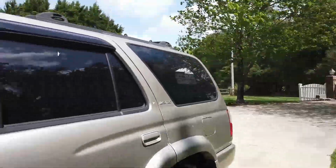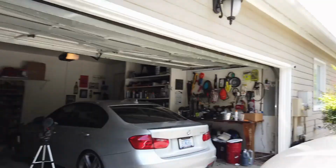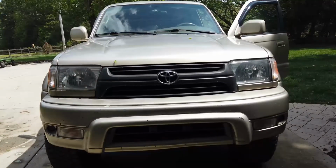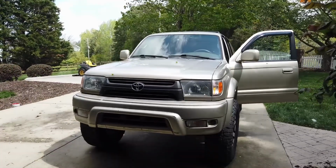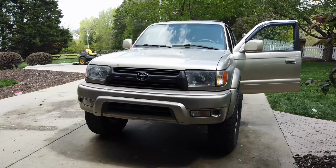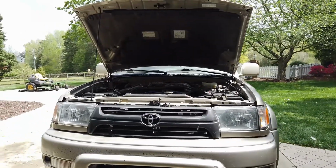So I got the other wire repaired and taped back up, the black with the yellow cut. Let's turn this on and see. No more daytime running lights. Nice. If you guys know what that yellow and black line that I cut was, let me know in a comment. I'm curious, but make sure you cut the black with yellow that's in pin 12, kind of on its own by the side. Next, we're going to remove the grill.